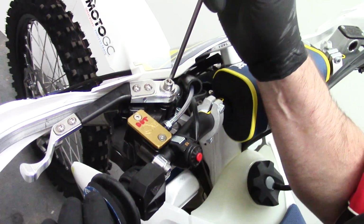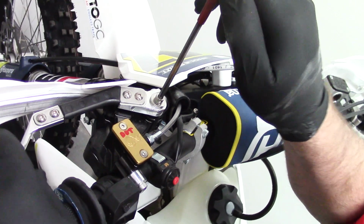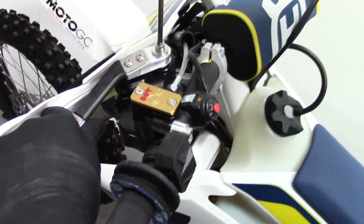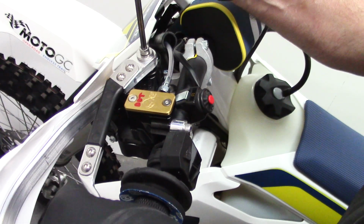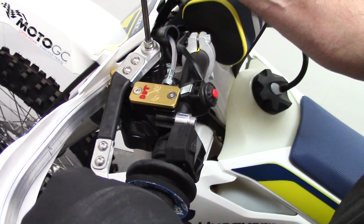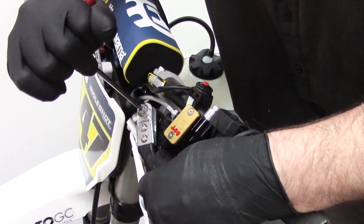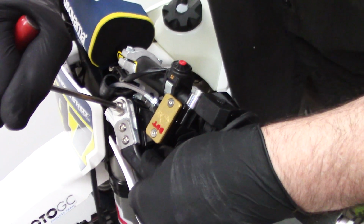With the One Light, you can position the lever in any position you wish, and you simply do this by loosening this central Allen head screw, and then you just put the lever, see how you can now move that freely and that's not rotating the shaft, and you can put it where you want it, and then you must firmly tighten this central bolt.